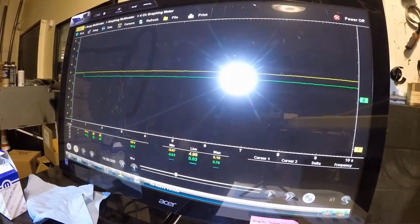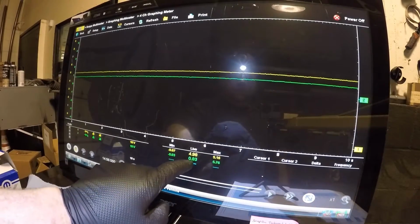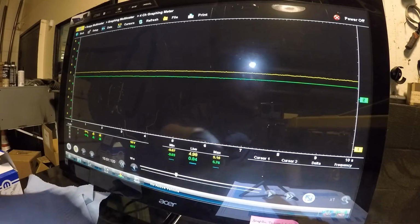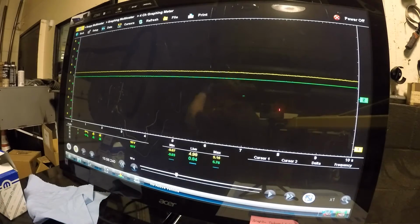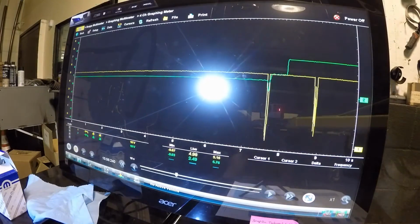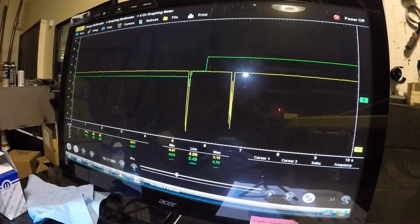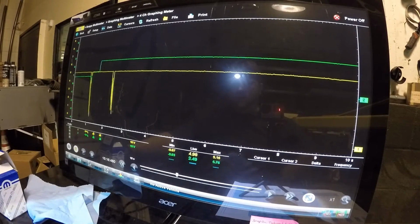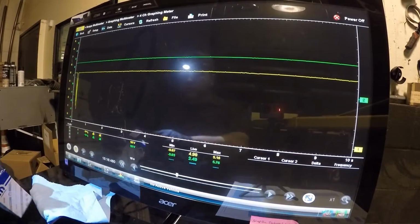Oh, and this is the way this works. Higher the pressure in the tank, the lower the voltage on this green wire. Higher the pressure, lower voltage. So, that's why I lost connection. So, remember that. That's it. I mean, by disconnecting that, literally, you can check the whole system.